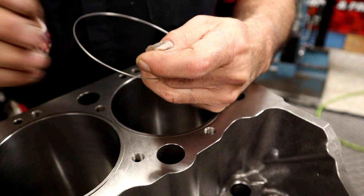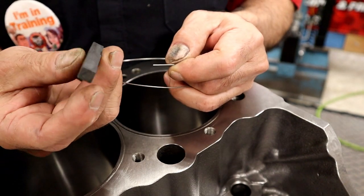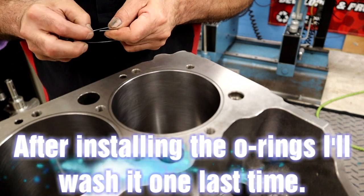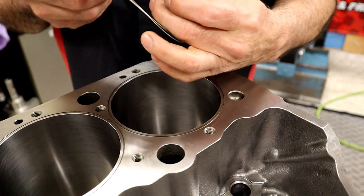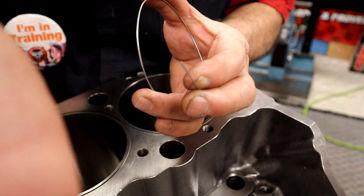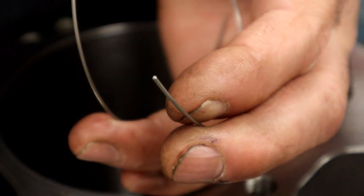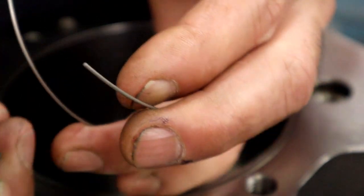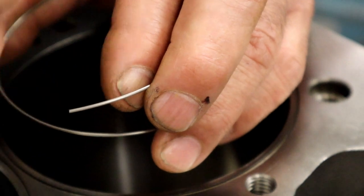Once it's cut, it is still going to have a slight little spot where it was cut. When you cut it, it leaves 2 indentions and a little bit wider on the other side. I take a honing stone to that spot that I just clipped. Now if you can see this or not, we will try. It's nice and flat now. I've taken a honing stone and just filed it. You can see the groove on the honing stone right there. It doesn't take a lot, even though it's stainless, to get a nice flat spot. So we want a nice flat spot.